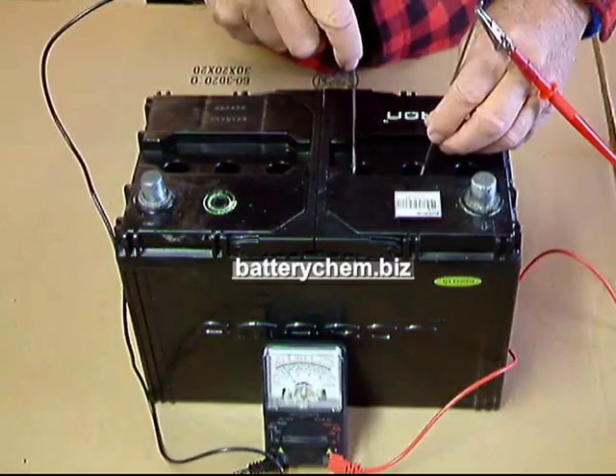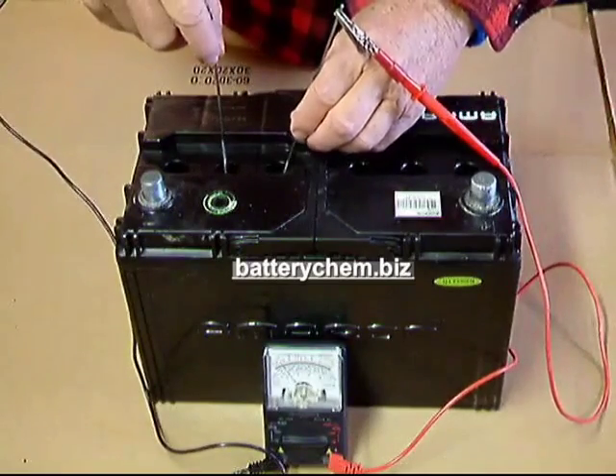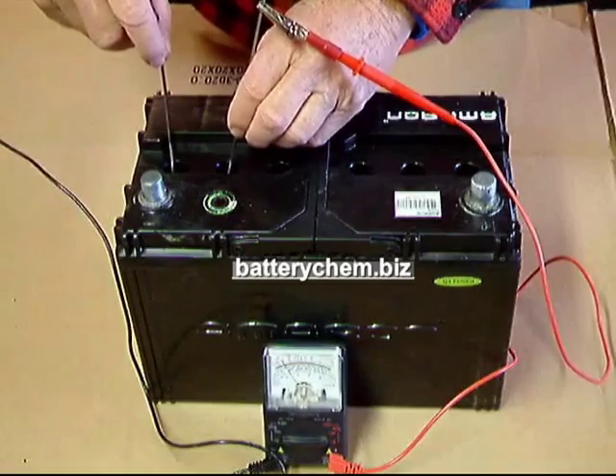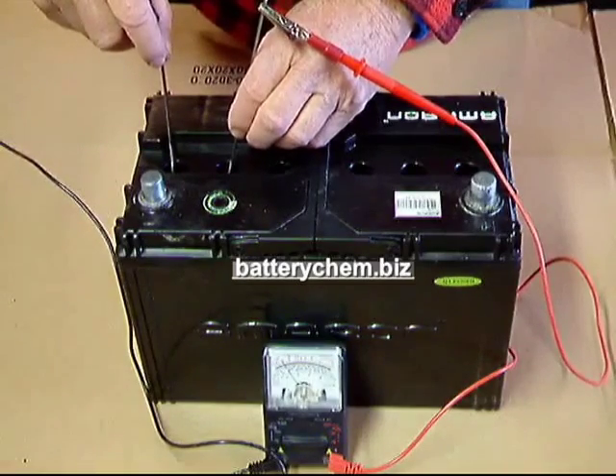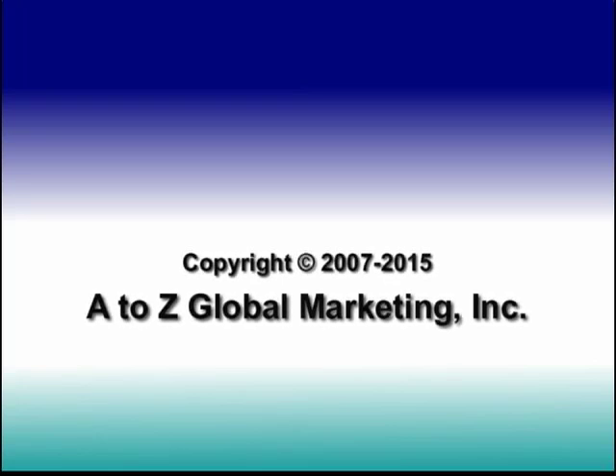Positive, negative. Positive, negative. Positive, negative. Positive, negative. You must get a reading of at least 2 volts for each cell, or you've got a weak or a bad cell. You can hear from them — the third cell is bad.